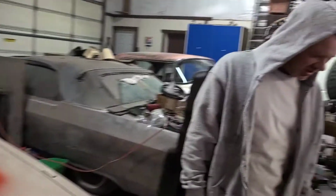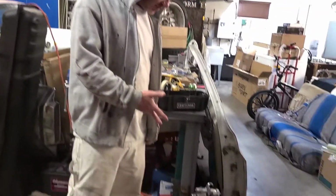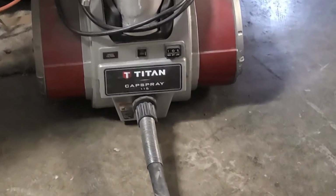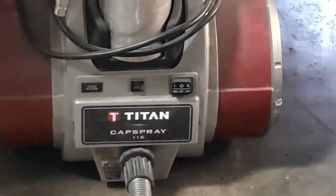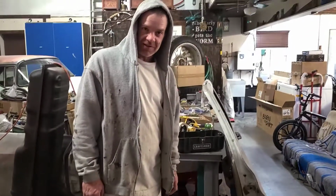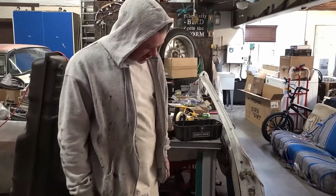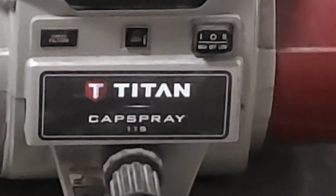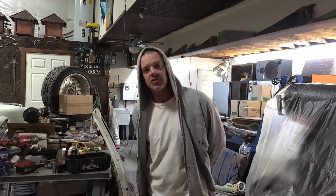As many of you see, what is this strange little contraption? It's definitely not an air compressor, is it? No, I never paint cars with an air compressor. We can get to that later. But this is what a turbine looks like, a 5-stage turbine. Now this thing only works off 11.5 pounds of pressure, so it's a little different than your 45 to 60 pounds off the compressor. But we'll get to the pump later. For now, first coat is applied. Michelle and I are gonna give this thing a moment to tack up. We'll get back with you in a few minutes.